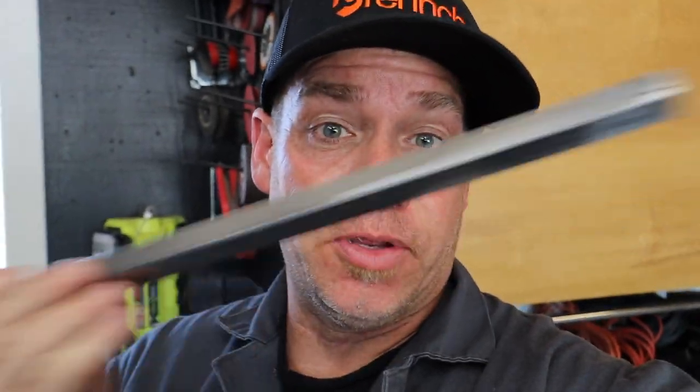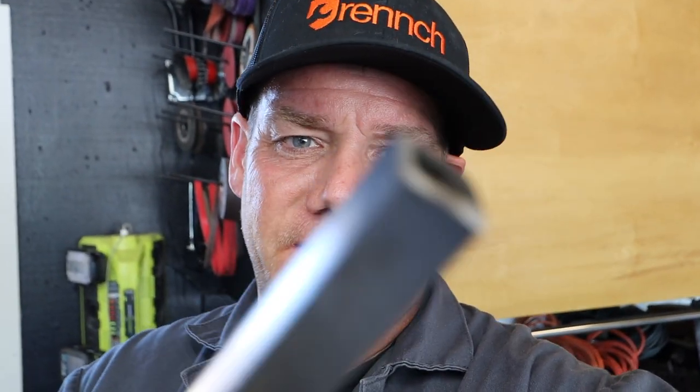So this is the bar I'm using in between. I've cut it, I've ground the edges here, and I've given it a wipe down with some acetone, because there's so much schmutz that comes on these things from the metal supplier. So this, I'm gonna put a tack in, I'm gonna stick the level on it. Maybe I'll stick the level on it first, just so I have it pretty close. And then I will weld this thing on, then try to remove the entire assembly so that I can weld the whole thing up.